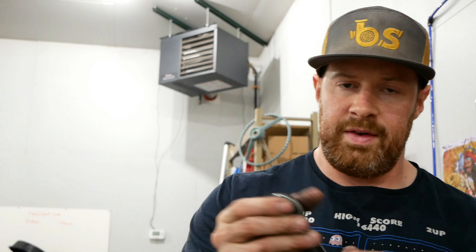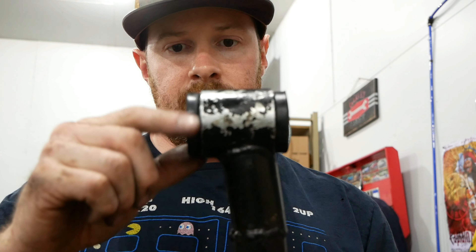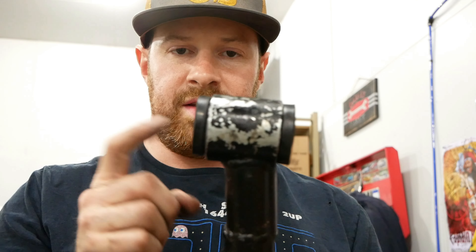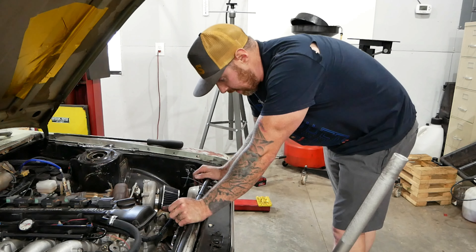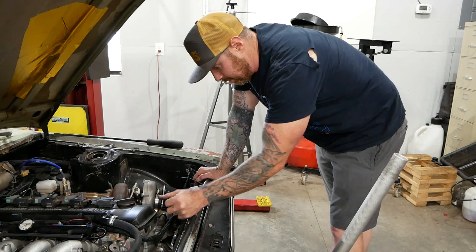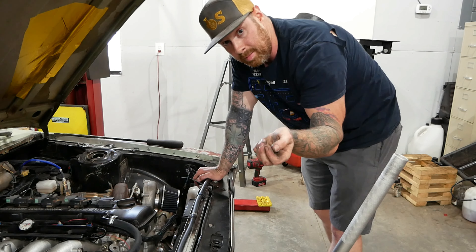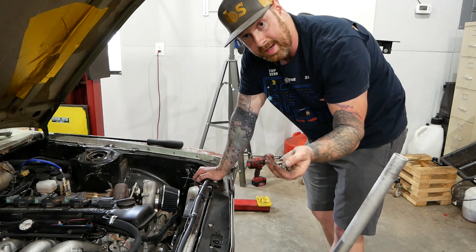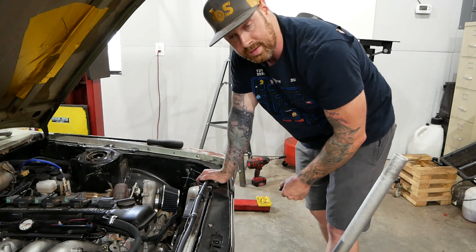After about 15 minutes or so of shaving these down and running them on the grinding wheel just to kind of flatten the slip out, I think this is just about right — good enough to fit in there. With a little more shaving on that rubber bushing, it dropped right back in between the ears just like it did with the poly bushings. I already have the main motor mount bolt through, so now I'm going to line up the bracket with the block, put the four bolts back in the block, get this side all nice and tight, and then go after the passenger side.